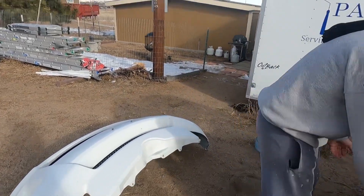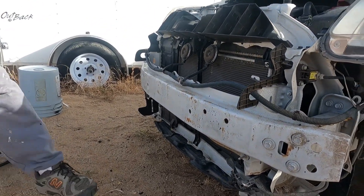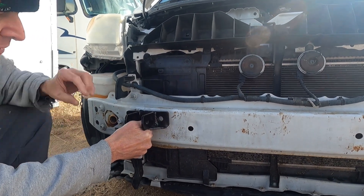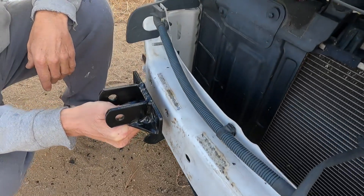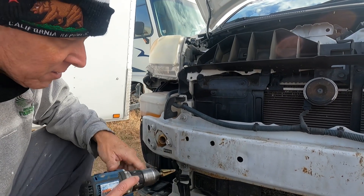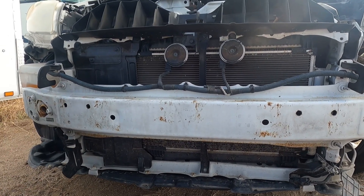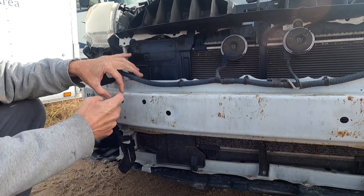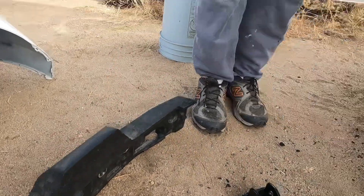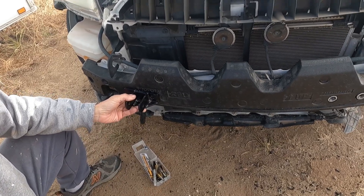As you can see right here, this is actually the foam absorber, and that comes off as well. I decided to mount the brackets here, and once again we have our foam reinforcement in here, so we have to compensate for that. I've already drilled out the holes - two holes here and two on the opposite side - this is where the bracket will actually attach. The foam absorber means you can't just mount the bracket outside the foam because it will just crush.